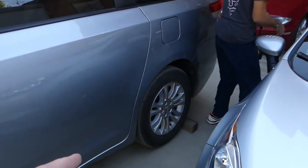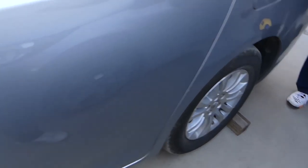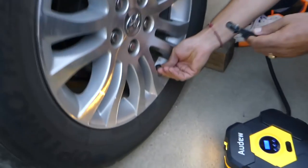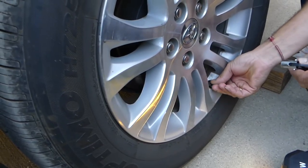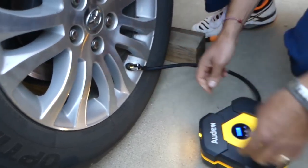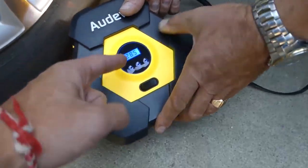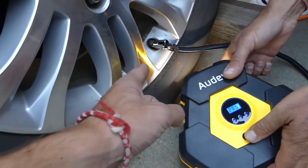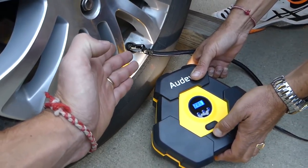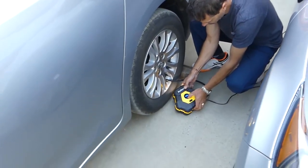Let's check the van — it's supposed to be 35. You can notice really bad fuel economy if you have low tires: first it's not safe, second you'll be using quite a bit of gas. It's at 28.5 and we have a tire pressure sensor in the car, but it activates probably at 26, so it doesn't show us that we have a low tire.